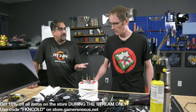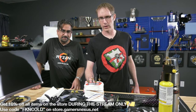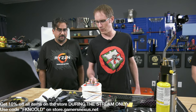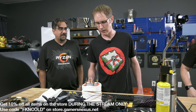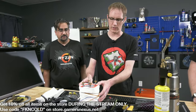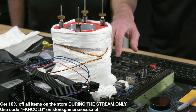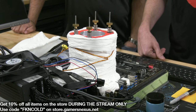The reason we use heaters even though we're trying to go cold is that the only thing we want cold is the CPU itself. We want to keep everything else above the dew point to combat any condensation. That's why we use the heaters underneath the board. The pot underneath is covered in a bit of foam, and then I like to use janitorial rolls of paper towels because they're not perforated.